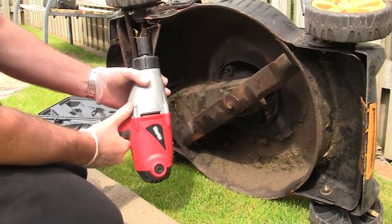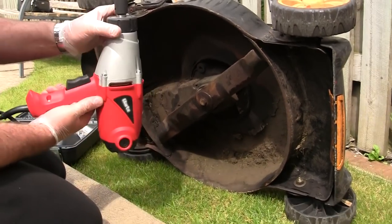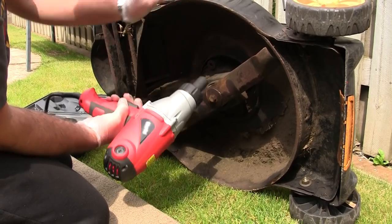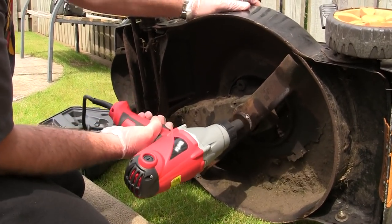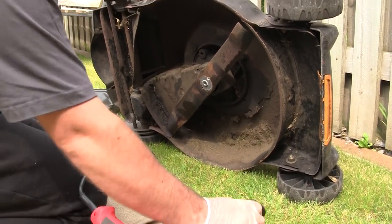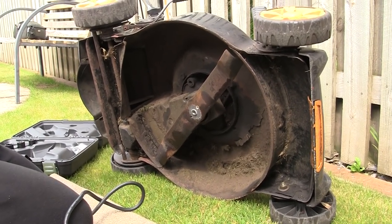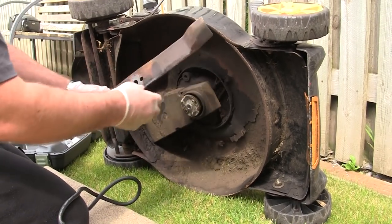Right, so I've got this Clark impact. In fact, I'll put a link to both of these, this Ryobi and this Clark, in the description of this video. This doesn't have adjustable speed, but it's never failed to undo any of these. I'm using an impact socket now, which I should have done before as well. You can see the difference there, that's come off in seconds. That could have taken you all morning to do. It used to take me about an hour sometimes to get them off. So having the right tool really does help.